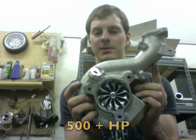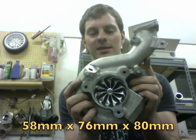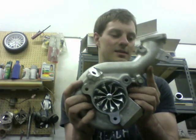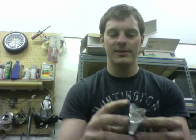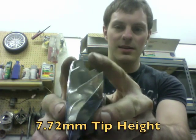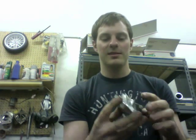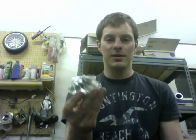The compressor wheel is 58 millimeter by 76 millimeter and it's extended to 80. The compressor wheel also has a 7.7 millimeter tip height — the tip height is this measurement between my two fingers — and that's the reason why this wheel flows so well.